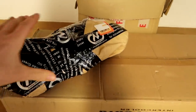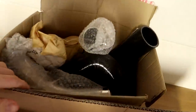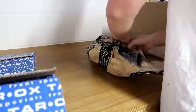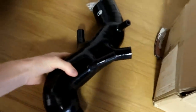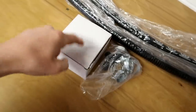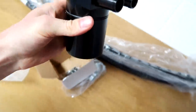I have a front mount intercooler and all the piping - that's all ready to go. And then I've got this, which arrived the other day - that is my oversized turbo intake pipe. So I've pretty much got everything. The other thing you can do is remove a bunch of the PCV system, basically remove a bunch of stuff from the engine bay to make it less complicated. There's less stuff to fail, and one of the ways of doing that is a catch can system. Here we go - catch can and all the piping.